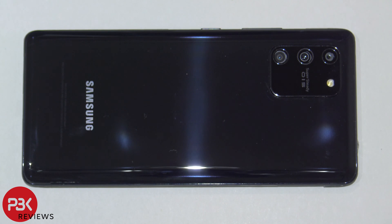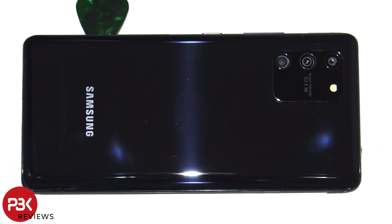Just to let you know, the adhesive on the back of this phone is very strong so it's going to take you some time to pry it off. Once you've got your back heated up, go ahead and insert your pry tool in one corner of the phone between the frame and the back plate, and then work your way around prying off the back.